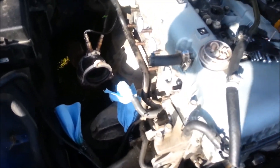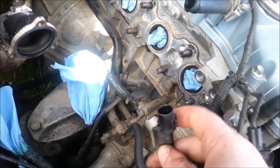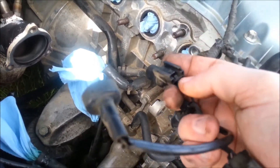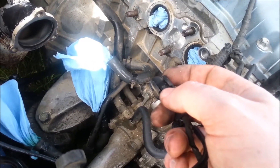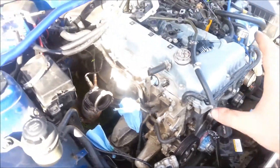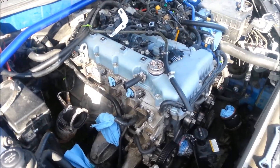A little tidbit: we were talking the other day about this clip on that bracket and I was saying how you'd have to undo the little base. Well it turns out you don't — there's a little plastic clip right there. Put a flat-blade screwdriver through the back, lift up, push it out, and it just pops out. No need to undo any of that complicated stuff. This side of the engine bay wiring is completely undone.